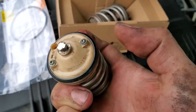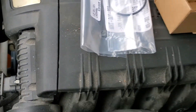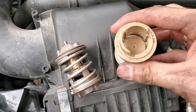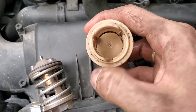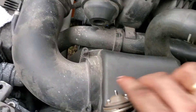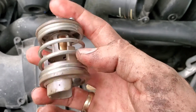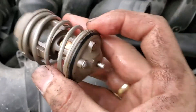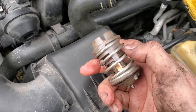Here's the new thermostat from Porsche — and of course both of them have a VW part number, it's a VW product. Here is the big difference I've noticed between the new and old: the old one has no passages on the back, it's just a sealed part. The new one does have holes that pass right into the inside, and the jiggle pin is actually there.